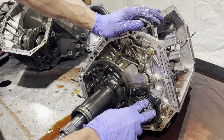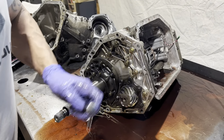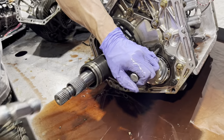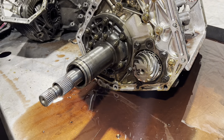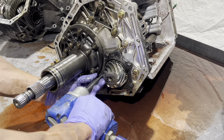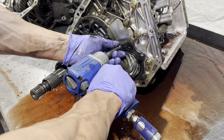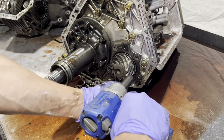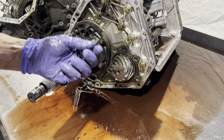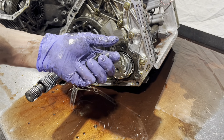Next we have our pinion here. These can get tight, so for these big torx bolts I like to use a punch. There's a bunch of 14-millimeter bolts under here. And it's interesting — just from the gear oil sitting in here over the years, you get a burnt hair smell coming out of these bolts. It's kind of nasty.